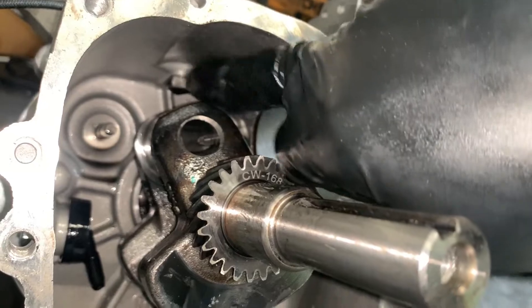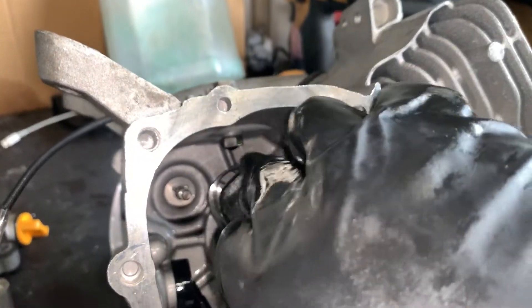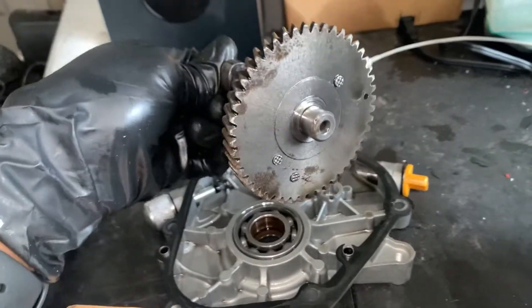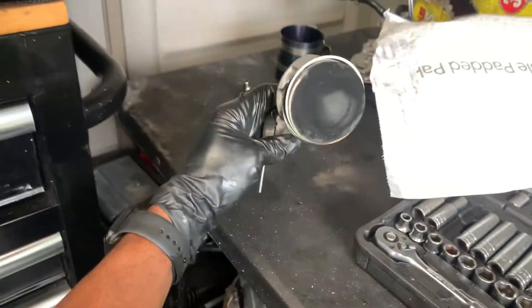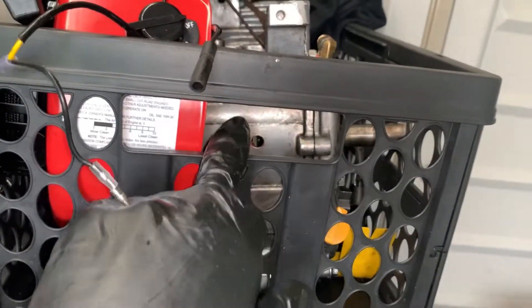About to start mocking this up. I know I got to trim up there in the top, hit back up here, then clear on the crank journal itself, and most likely in between the cam. This cam is just a 265 cam I had sitting around — that's why it looks a little rusty. I put oil on it when I put it up. I'm gonna put this piston in another Predator I got right here. It needs a piston, and I gotta close that hole up too.